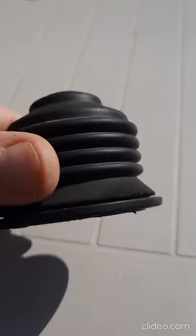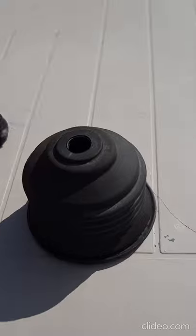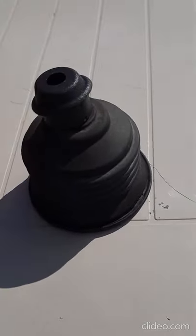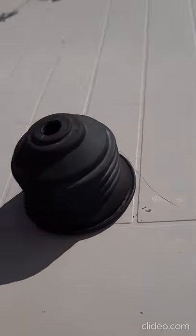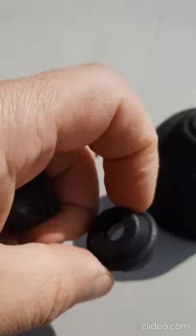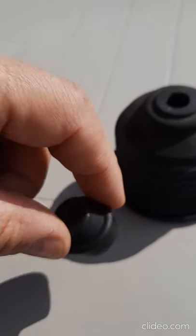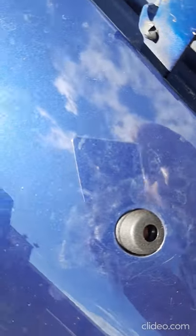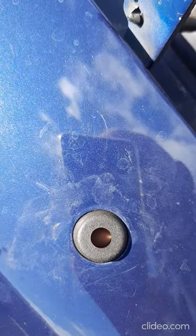Underneath the antenna on the inside is this piece of rubber. This one is rubber, and this one sits on top. So you stick the antenna from below upside. This one has a small edge, so you really have to push it through the metal so it really plops. Pushing it down from the top didn't work, so I do it by putting my finger in from underneath and pushing it up.